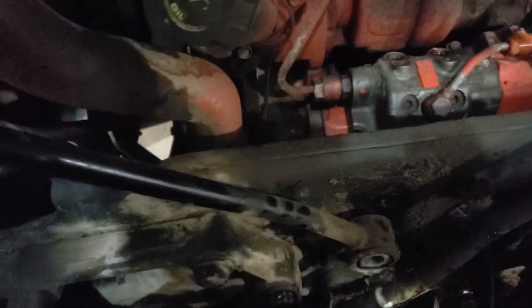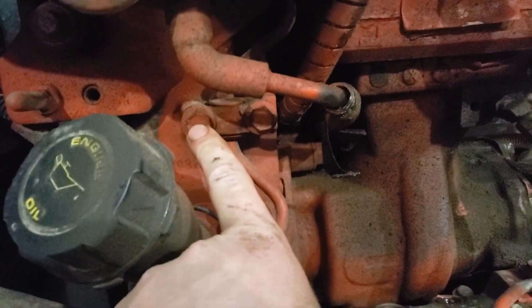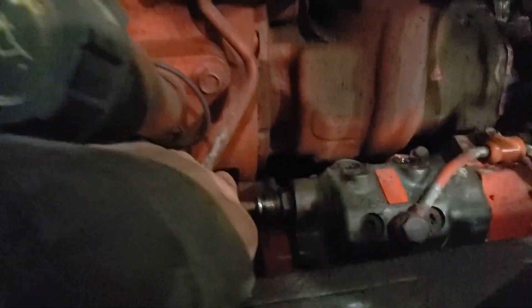The high pressure fuel line is a 7/8 wrench. You might want to use a crow's foot if you can't get the wrench on the exact right way. Just loosen it, spin the nut off. Then you have two bolts here you're probably going to want to take off — 13mm — zip them out and then you'll be able to move the line back. The line actually kind of sits into that fitting a little bit, so if we take these off then we can get a little bit more movement out of it.